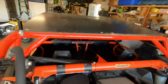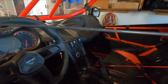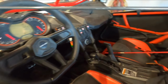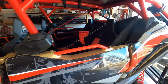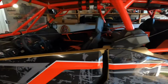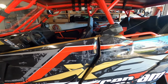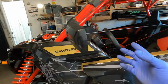Cap back on and start the engine for a minute or so. Let it warm up and check the water level and add more as needed. So after you run the car for a few cycles, make sure you don't rev it up. Just kind of let it run. Cycle the coolant through, or the water through.